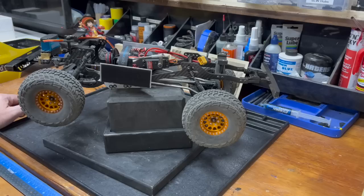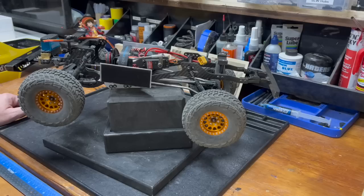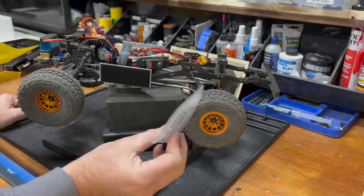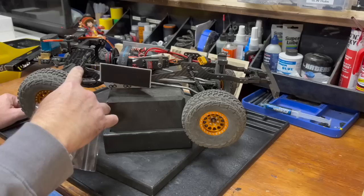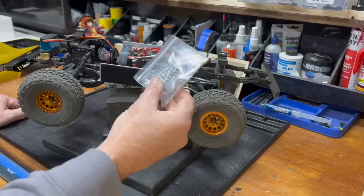And snap rings. But the snap ring is also kind of a plus — that bottom is not going to leak; that O-ring pack is in there. On a vehicle like this, 40-weight seems great. I will have to take the bottoms off and look through the spring pack — these are probably soft. What came on there needs to go to a medium because it just collapses. There's a lot of weight out front especially with the skid-forward layout. But tuning options are not crazy expensive.